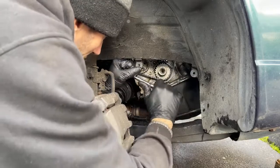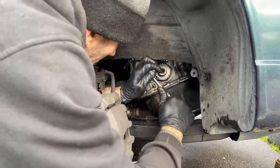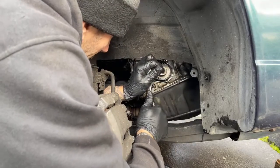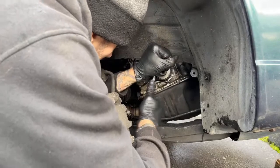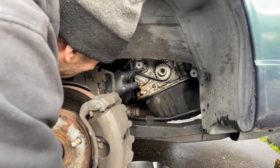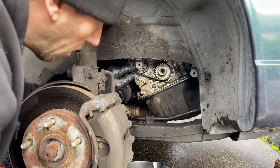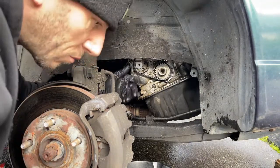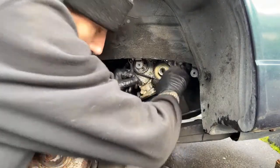That's a little turn there. That's a little turn there. That's a little turn there. This one up here. And there. Oil seal behind this oil pump sprocket is still dry. I'm gonna clean that up again, put this back together, and run it and see if that helped or if it made it worse.